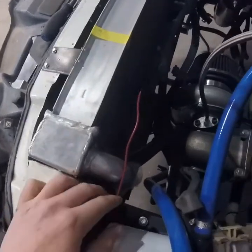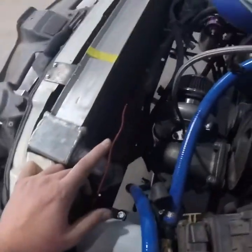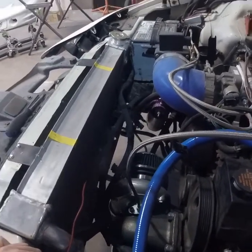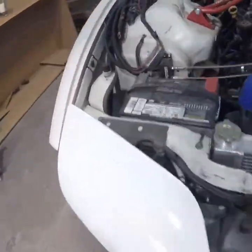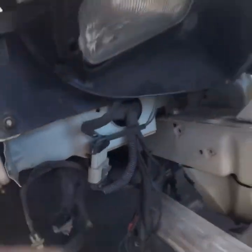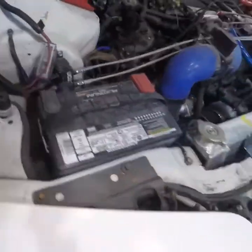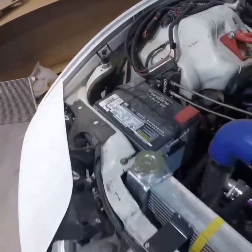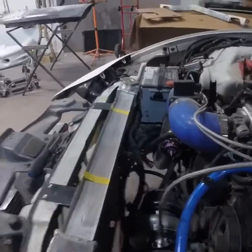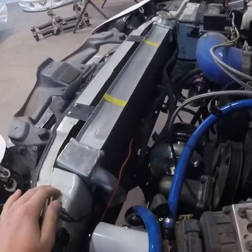I need to find upper and lower hoses for it, and I also need to do a coolant overflow tank. The factory coolant overflow comes down through this hole and was in the way of everything. It's actually part of the battery box on these cars - all built into one piece with the little reservoir. I stuck a pry bar between the two and broke it off, so I can still use the factory battery box, and it's locked down nice and good now.